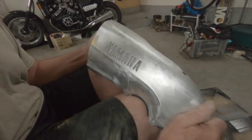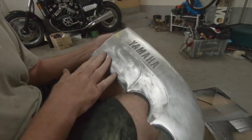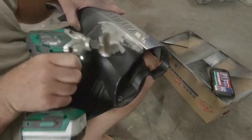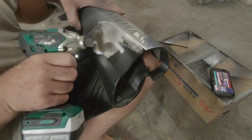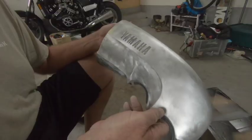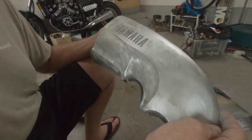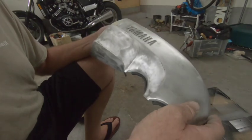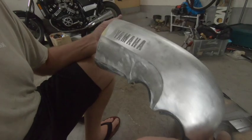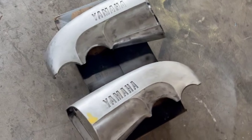So here's the side vent that we repaired yesterday. Now you see I've taken all the black off. I actually took it off with a brass wire wheel, so not too strong like steel, because I just wasn't sure what the paint that was on it was. So now it's all off, and we've got a good base. We'll wipe this all down with thinners before we start, but we'll put 3 coats of primer on it all and rub it back, and we'll get a really nice finish now.